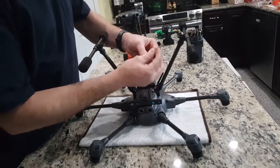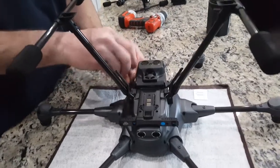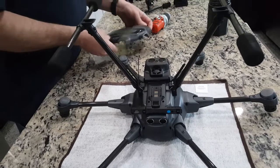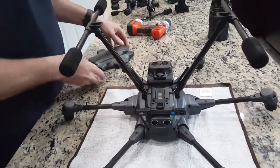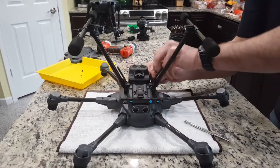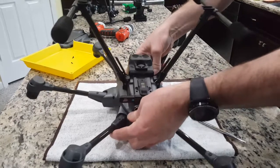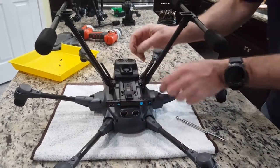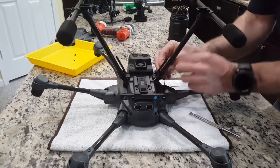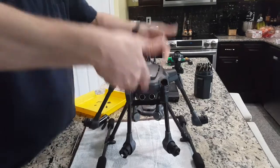So here's the one screw — I believe this is 1.5 millimeter Allen wrench. You're going to take these ten screws out of here: one, two, three, four, five, six, seven, eight, nine, ten. Just those ones are on there, then we can get the top shell off. When I'm taking these screws out, I'm not locking these legs in — just leave them laying loosely like that and set it on your towel. If you lock these in, you put pressure on here and you're going to be popping these legs loose and weaken that joint. So just let the legs hang out there.